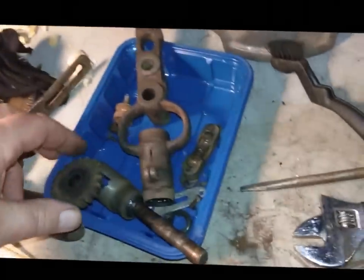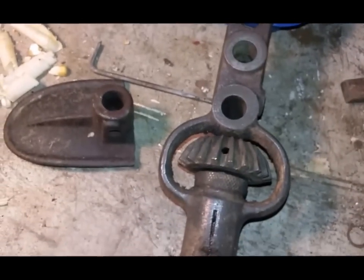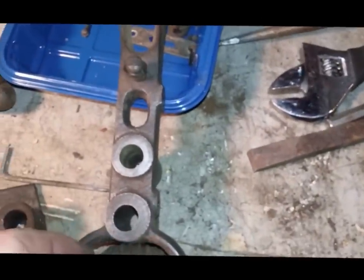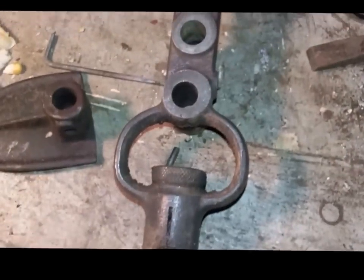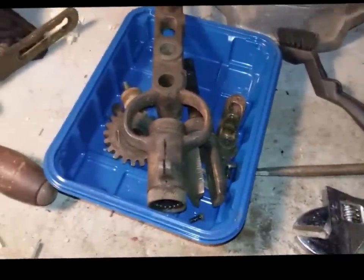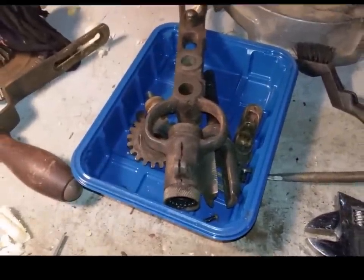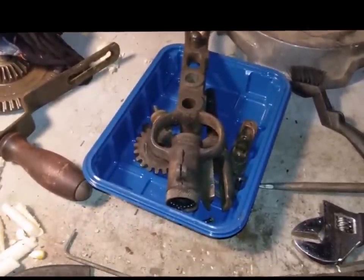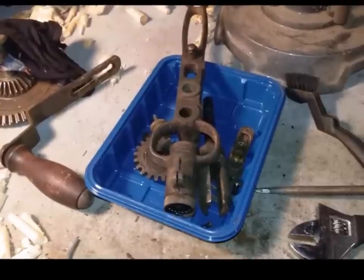The way I managed to disassemble it, I was able to drive the shaft out of the gear, then pull the shaft loose and move the gear, then pull the chuck spindle out — being careful not to drop any more of the balls out of the bearing. I'm going to take care of the rest of that tomorrow; it's getting kind of late tonight. But now the mystery of how one of those goes together is solved, at least for me — and now for you. Thanks for watching.